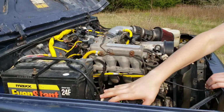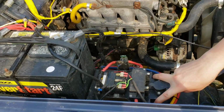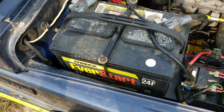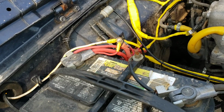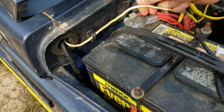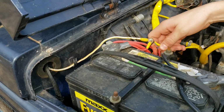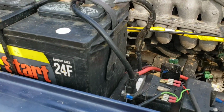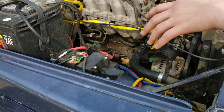So over here we have all my winch stuff on this custom battery tray we built that has self-tappers here and 2 under the battery. And then this is, well, technically a little dangerous because these are all the hot wires. So this is the constant hot that goes to the computer. Everything was labeled in the kit. And then this is a hot wire which goes to the alternator. So this is all the hots, and then the grounds just go down there and fault out.